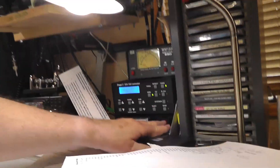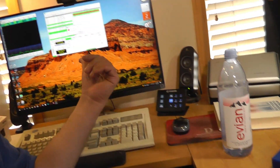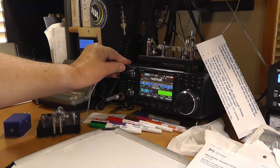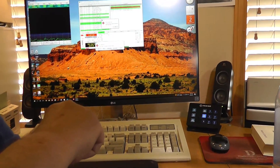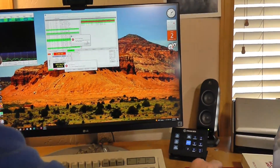Another thing you can do if you have that problem is not only shut down the ICOM, but shut down the power to it. I'm going to turn off the power to the radio — I should have turned the radio off first. You just heard the speaker letting go of it. Now if I turn this power back on, the radio comes back on. I'm going to turn the radio off. It's connected — it thinks it's listening to it right here. Now let's turn this off and listen to the computer. There — you just heard it. It says error in sound input.